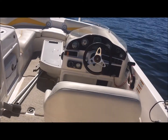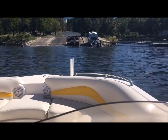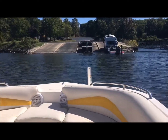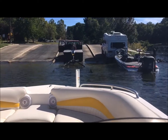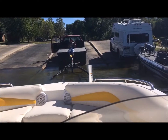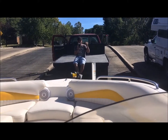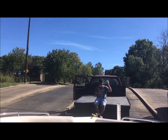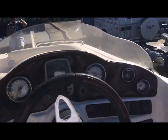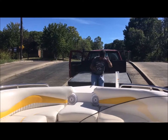So there she is. We're going to go get it back on the trailer. I just want to walk you through a few things. Taking these boats in the water is easy. Taking them out gives people trouble because they get the trailer too deep. You see how I can see my guide bunks and my front bunks. This trailer is made for this boat only, so it can't get crooked as long as we get it towards the middle. Just nothing herky jerky — slow and steady, applied pressure. I'm just easing it on. There we go — good to go.